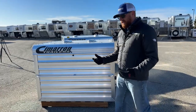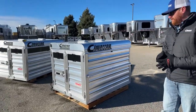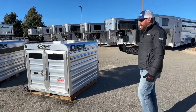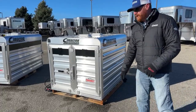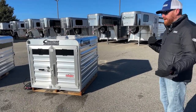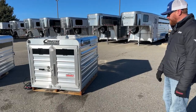There can be some customization. If you're running a Nissan or Toyota, those have narrower wheel wells — running about 41 to 42.5 inches between wheel wells — so the standard 48-inch width won't fit. These can be custom built to fit those sizes. We'll just need about three to four weeks to build what you want. We've also had customers build them wider to put on a flatbed, and we can do other lengths. There might be a slight upcharge for customization, but it can definitely be done.